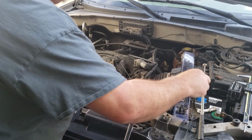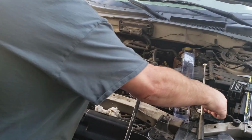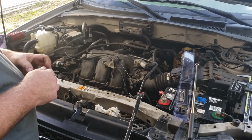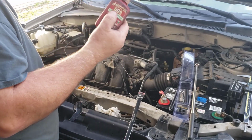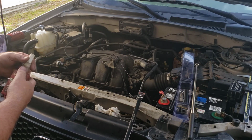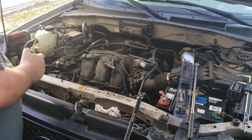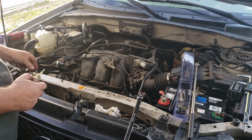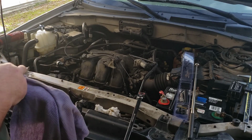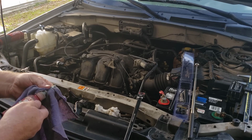At this point in time, like I said, we're ready to try this out, and there are a couple of ways we can go about it. There is an actual tool. And this here is a Loctite 609. This is green. It's a retaining compound, as I said. It's not just a thread locker. The difference, if anybody wonders, is that the amount it will seal, the take up, is a lot greater on this stuff than on the other stuff.